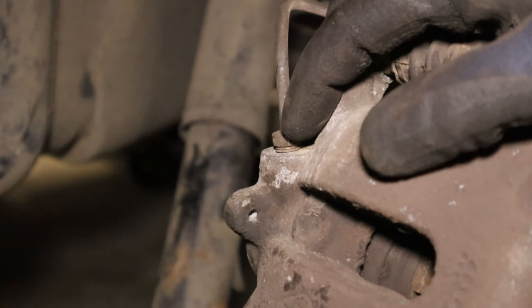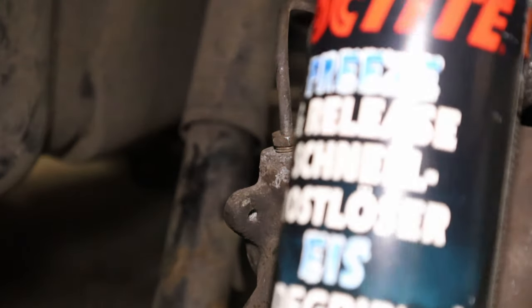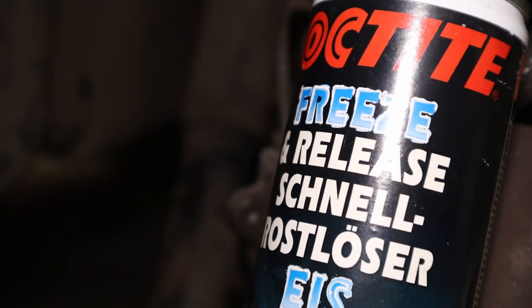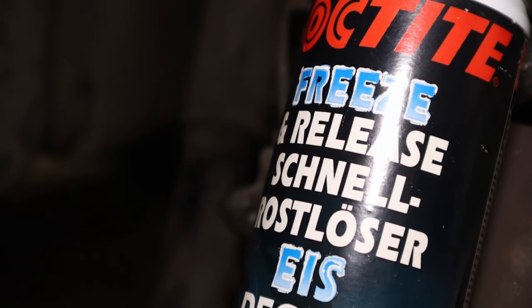Okay, now most people will go for heat here. I will if I have to, but first we can go in the opposite direction with freeze spray. This will cool down the union and hopefully break right through that rust. So read the instructions on whatever brand you choose. I will leave a link in the description to some.